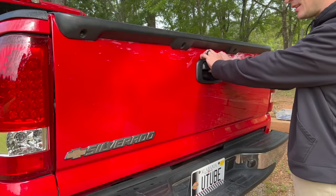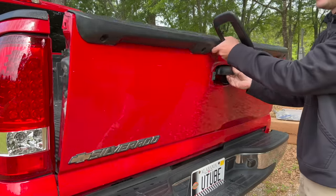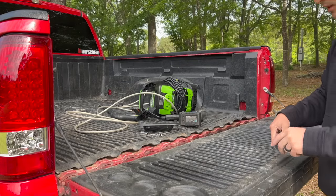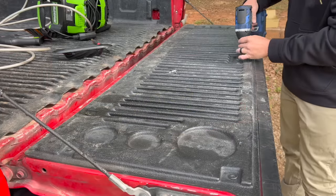Let's start on the outside and work our way in. Let me show you how I've been having to get into this thing — take the bezel off, this side's broken and that's how you drop her. There are two bolts exposed but there are actually three bolts holding that on, so we've got to use our T20 and take this plastic cover off first — these are half inch.